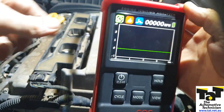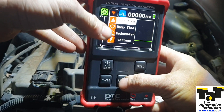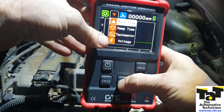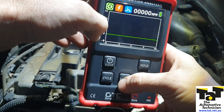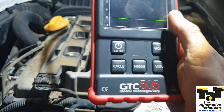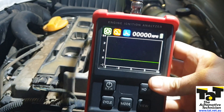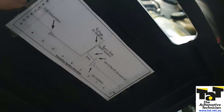We turn it on and going through the modes you'll see I can do burn time, ramp time — which is like putting a current clamp on a coil — or voltage, which is the voltage required to create the spark. And tachometer, obviously you know what that does, but it's not that helpful. I keep it in this carry case and you'll see this is a waveform.